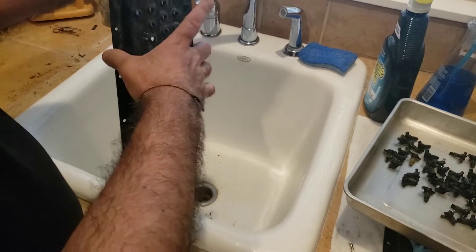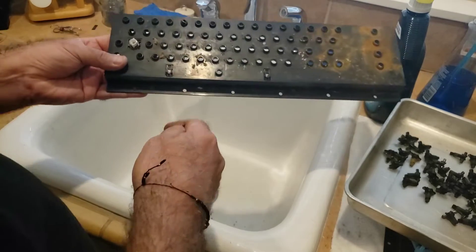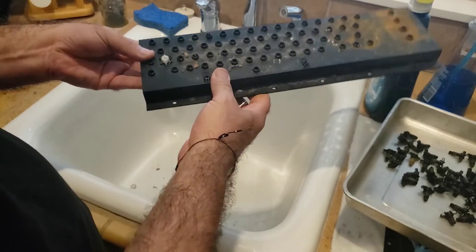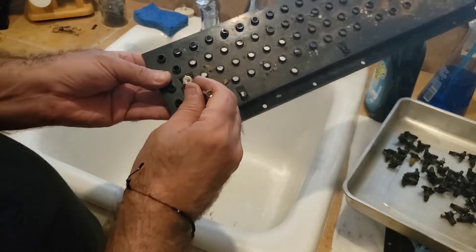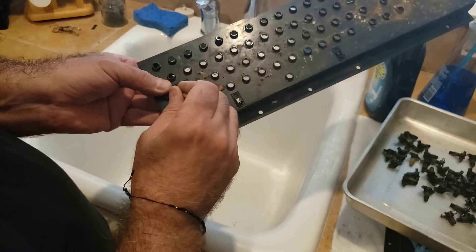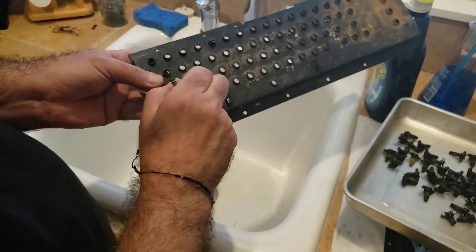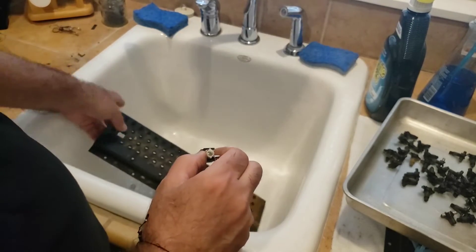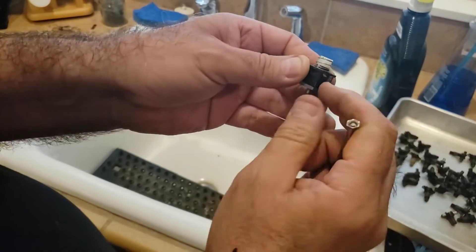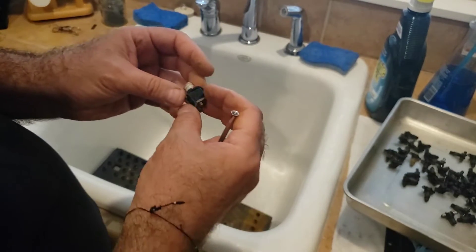I'll replace the ones with broken stems and then the others I'll just give a nice light wipe with alcohol. This thing we're going to wash — we're going to take the shift lock key out. There are two little tabs that keep it from popping up that you have to push in while pushing this up at the same time so it slides up — one here and one here. Push them in just a little bit, get it started, and then it should slide right out just like that.